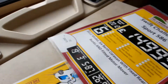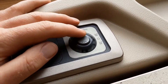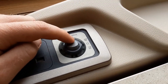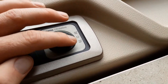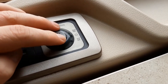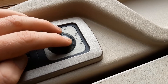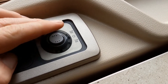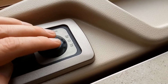Up on your front cabinet you'll see a switch labelled 'Ultra Store'. You have the option to run 50 degrees of water temperature by flicking the switch up — it will self-ignite on gas if it sees a gas supply. You'll get a green light if it's ignited and a red fail light on the opposite side. If you want to run the water heater on gas at 70 degrees to warm it up fully, you can, and you can also use this as a boost when you're showering on board the caravan.